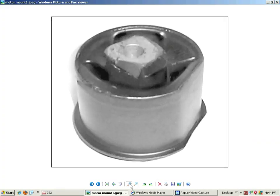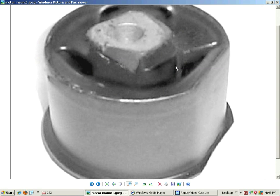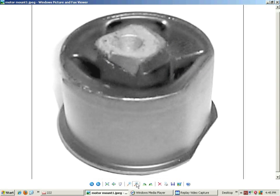Here's a close-up of a replacement part. So you notice they're all hollowed out, right? And so what I did was I used brake cleaner, cleaned this up really good, let it dry. After it dries, clean it up really good so the rubber's chemically clean, and then I'd fill this up with urethane windshield adhesive, then let it dry for a couple days, and then it's like one piece of solid rubber. Because typically what happens is these things break inside, and they don't seem to last that long.